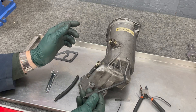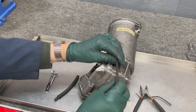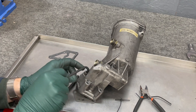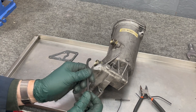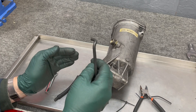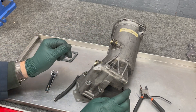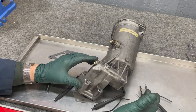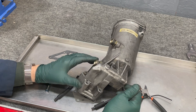You want to tighten them down evenly and then torque them. If you need a little bit more torque with this wrench, you can add a small piece of pipe for more leverage. This rubber hose has been put on this wrench to keep it from twisting — when you're working the bolt, the wrench will want to twist, so the rubber keeps it straight since everything will be oily and greasy. Get them all snugged down and then as tight as you can get them with the hex wrench, then tighten up the oil cooler lines. Hook up the oil pressure line on the w116 and w123 — on the w126 it's electric, you plug it in — and then the banjo fittings on the turbo model for the oil line that goes up to the turbos.